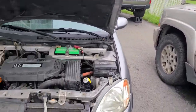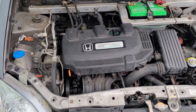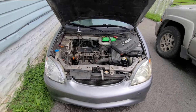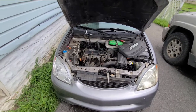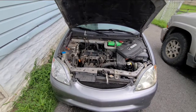We've got a lot going on today, but what this video is about is changing the spark plugs on this little Honda Insight. To start the spark plug job, you'll have to get the spark plugs, and each Insight is individually marked for the index of the spark plug so that it faces an optimal position for fuel economy.